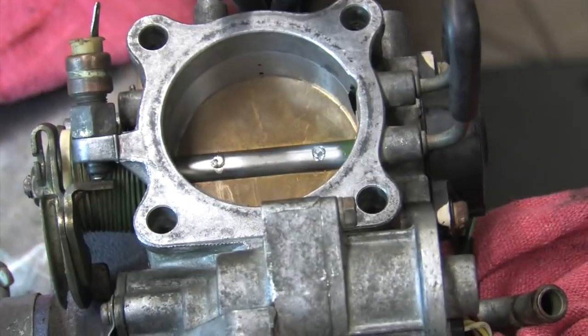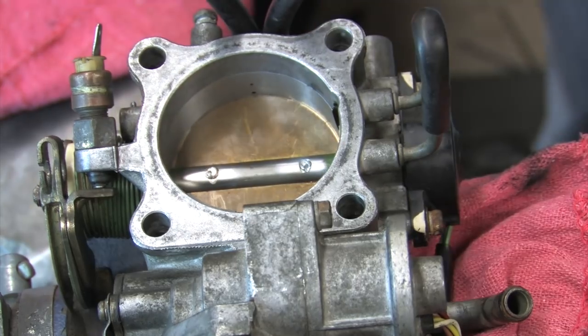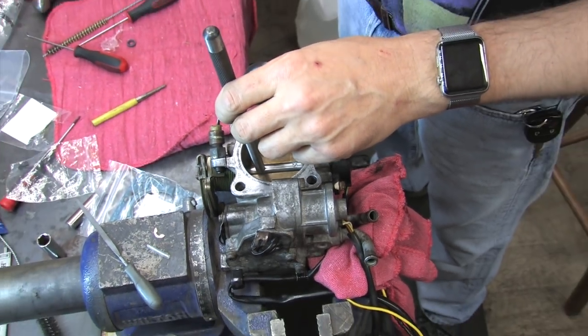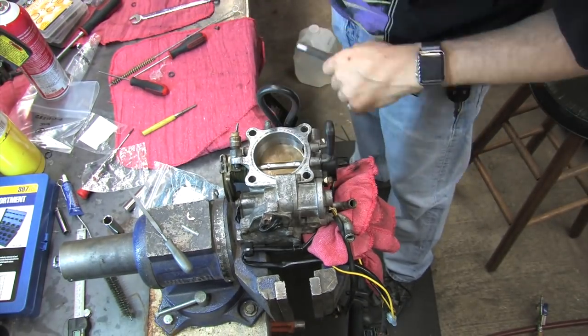Did you say stake? Yes, and it's complete overkill here. Peening simply means to smack it with a hammer to compress the surface of the thing. I just used a punch to help my aim. Staking pretty much destroys the part, but those screws aren't going anywhere now.